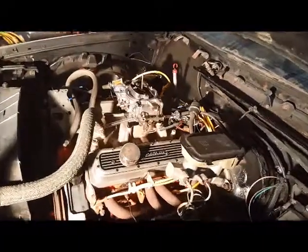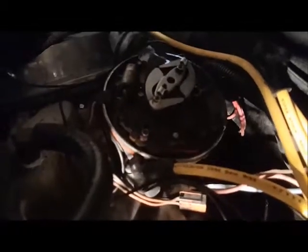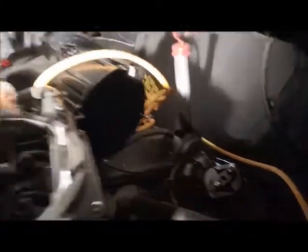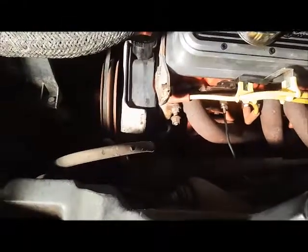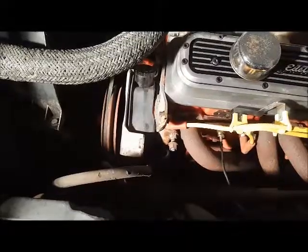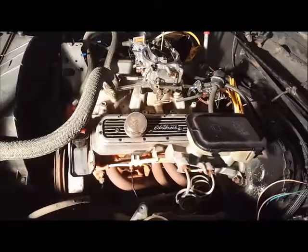So here we go. I kind of was messing around with it. I took the cap and rotor off here. You can kind of see what we have here. There's the factory module down there, and then there's the springs and everything, and the vacuum port there. There's the cap. I took the fan off just to get better access to it. It's kind of a pain to spin this thing over. I did take the number one spark plug out. So now I'm just going to turn it over and feel for the number one cylinder to come up and I'll put in my little tool and we can go from there.